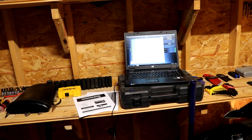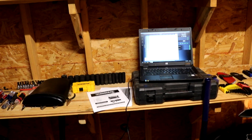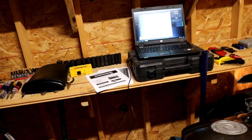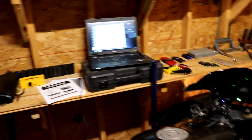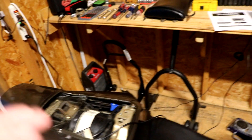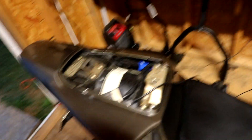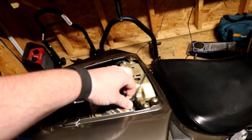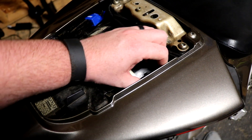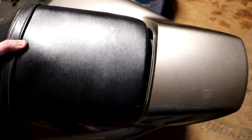I've read that after you send the map, you need to leave the Power Commander on and hooked up to the computer for about 30 to 45 seconds so it has a chance to load all the files you just sent to it. After about 30 to 45 seconds — maybe even a minute — go ahead and turn your bike off. You don't want to unhook the Power Commander from the computer while the bike is still on; that just seems like a bad idea. Then you can unhook your Power Commander, place it back in its spot, and pop your seat back on.